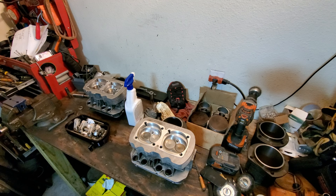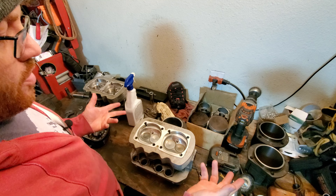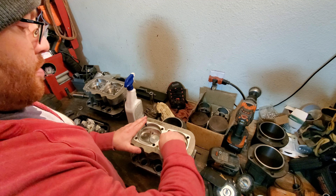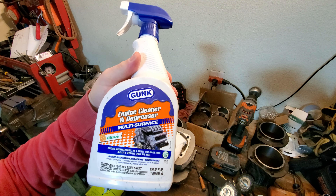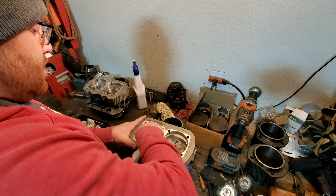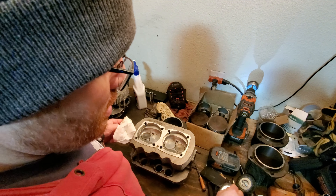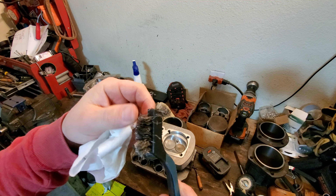Now back to the video. This bench was super dirty and I spent quite a bit of time last night cleaning up the heads. I used just some engine degreaser — this Gunk engine degreaser I got from one of the auto parts places. I left it on overnight and it did a really good job of finishing up the deep soak cleaning. Between my wire brushes and then a soft bristled brush with metal bristles, they did a great job.